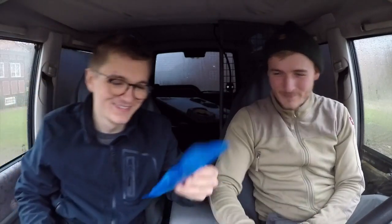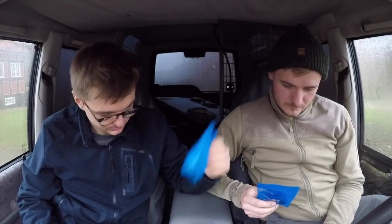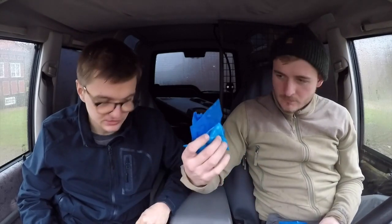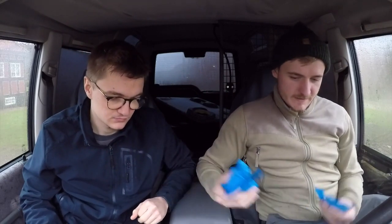We've got new parts for it from Get Off Road, including the air freshener Nissa was sniffing earlier - which happened to come with some useful parts. This is a seal kit with a selector bush, change pivot, and snap ring. We have those along with the clutch we just unboxed and hopefully a new gearbox in the near future. We also have power steering seals because it's leaking a lot from the high pressure side at the drop arm, so we'll be replacing those in the workshop.